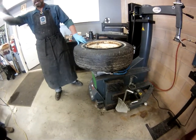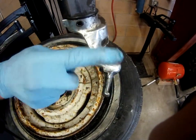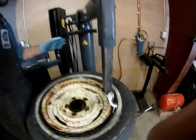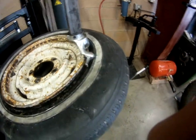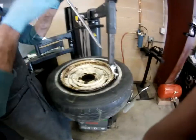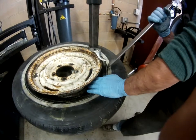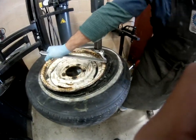Next comes the duck head. This is the duck head — this is the bill, this is the duck. It goes down on the rim and locks in right here where this handle's at. Now that we've got that locked in, we need to adjust it this way. I've got this nut right here, so I'm going to adjust it to barely, barely touching the rim. Then I grab my tire tool or tire iron — this part bends away from the duck bill. I stab and grab. So what I'm typically going to do is stab and grab, and bring this tire up over the duck head.